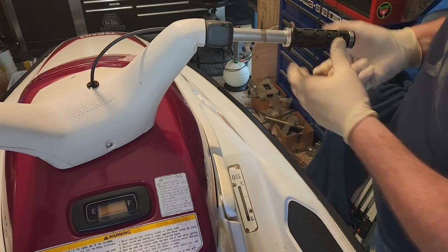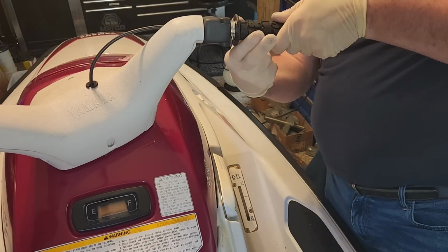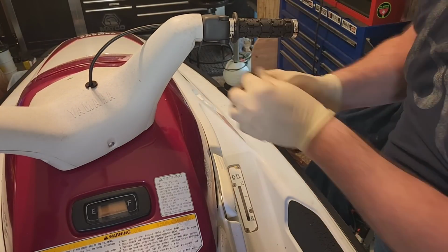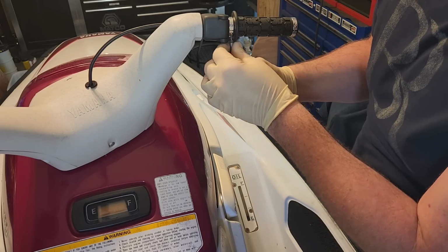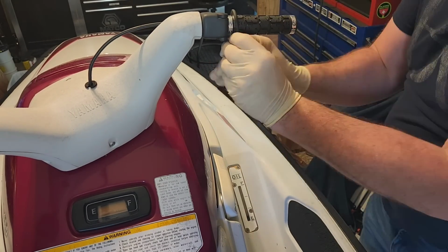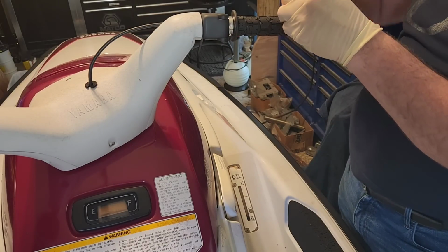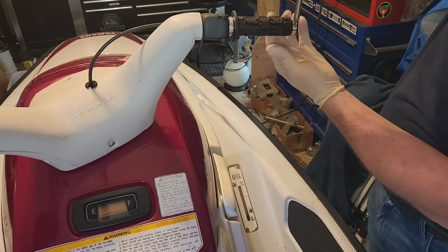If you twist the grip a little when installing it, it helps it slide over the tape easier. Once you have the grips feeling tight and secure with the clamps, you just need to be sure the throttle trigger cutout on the grip allows the trigger to open fully to the grip. The left side grip can be positioned whatever way you like. The final adjustment before you lock down the end grip clamp is to position the ODI emblem so you can read it properly.